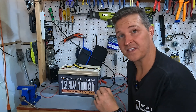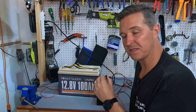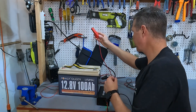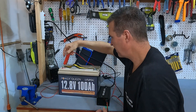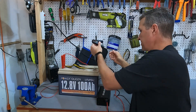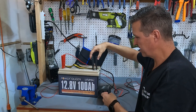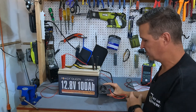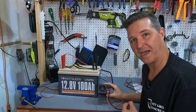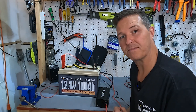Unless there's a fault, then the battery charger will shut off. But we know that this battery is completely dead and actually deactivated or sleeping. But if we connect up a lithium iron phosphate charger to it, this will go from a blinking green to a solid green or solid red, and it will instantly start charging the battery. This is the simplest way to make sure that your battery wakes up every time.